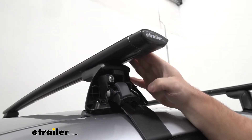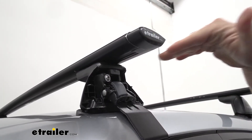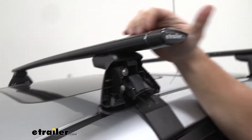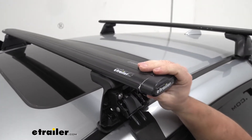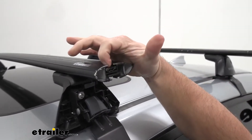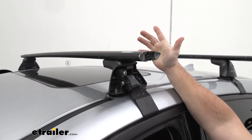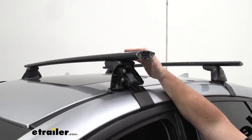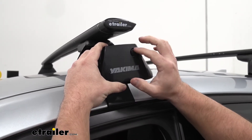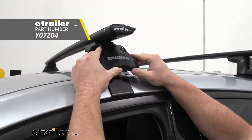The baseline attaches to the Jetstream via the T-track here on the bottom. You just take this cap off and slide it in there to get it started. It's got one on the top of it too with the weatherstripping in there, so you'll pop off this cap — pops off like that. You can put your accessory down in there and slide along the T-track. You can also use a clamp to clamp it around the bars if you have accessories that do that. Looking closer at the cover, you can pop out this plastic insert and replace it with a Yakima core so you can key-alike and lock it up when it's on your vehicle.